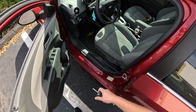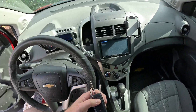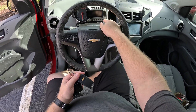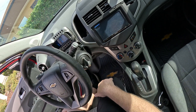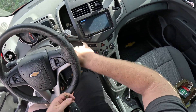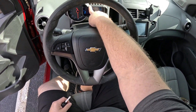I'll have to move the seat back. What you want to do is first put the original key in — there's a security light on top. Put the key to the ON position for five seconds until the orange security light disappears.